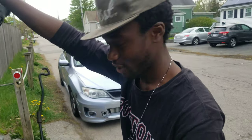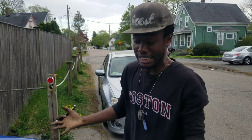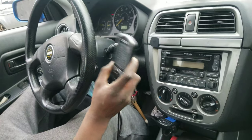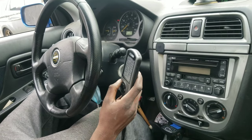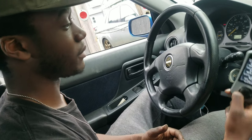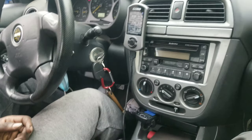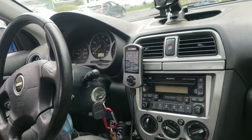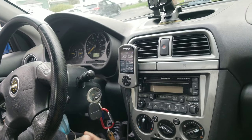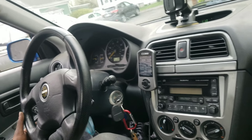We're gonna take it for a quick little drive, make sure no lights pop up. What I'm monitoring on the Accessport right now is boost and coolant temp — I'll probably change that in a bit. The DAM shot back up the moment we did these spark plugs, which I think is a good thing. AFRs are good. I'm also watching wastegate duty cycle since I'm on low wastegate and wanted to see what it actually opens at, plus feedback knock — mine normally stays at 2/11, sometimes goes to 4/11, but as long as I don't physically hear it and I've got oil in there, I'm fine.